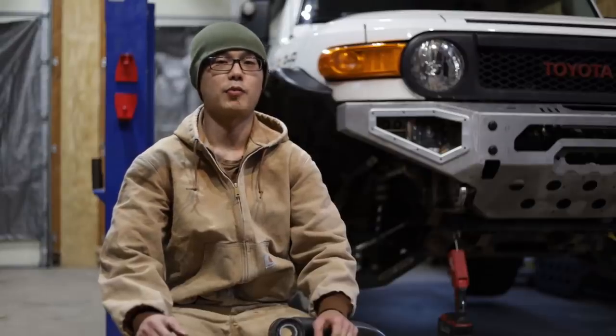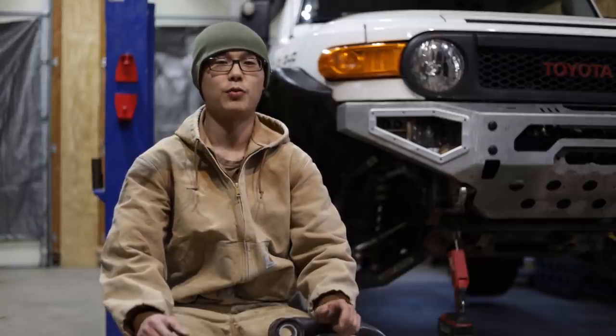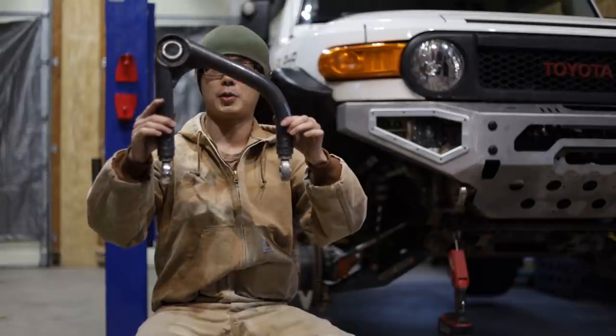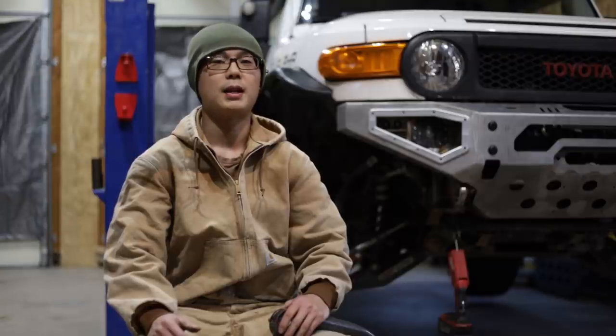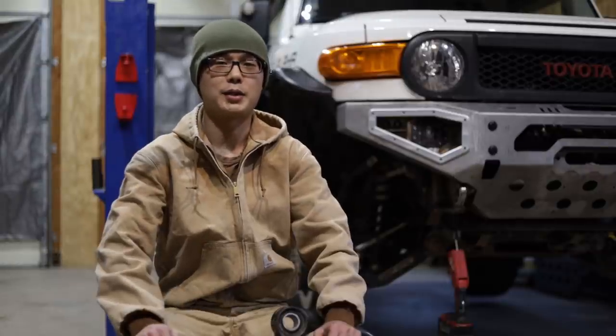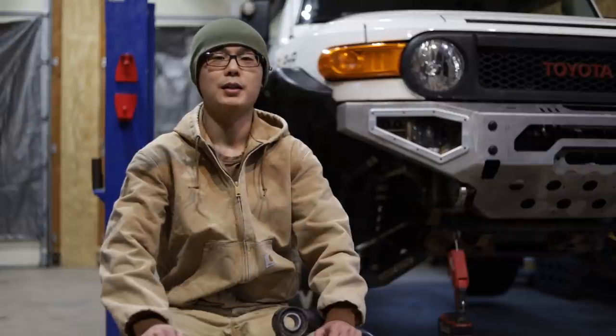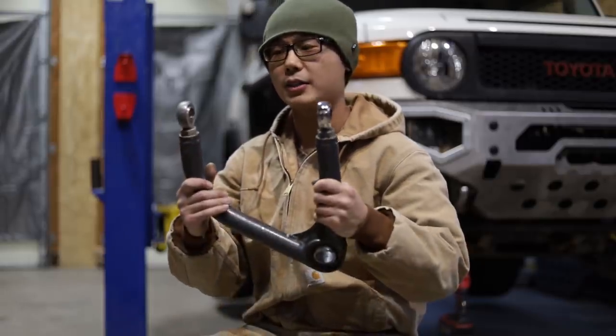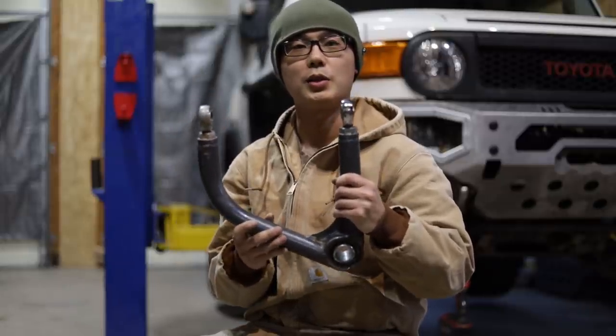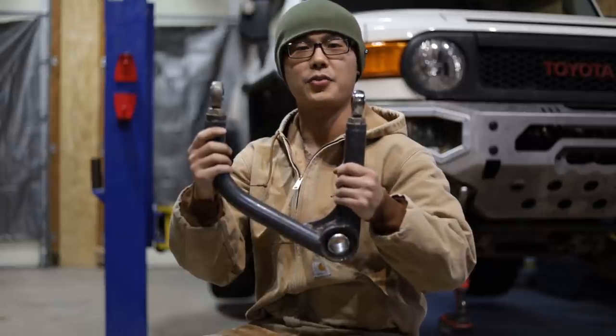Let's come back to the topic of wheel placement and wheel alignment. Our goal is to move the wheel forward to clear large tires, and we saw both designs can achieve this by a decent amount. However, due to Camber's high-caster upper control arm, I ended up with around 6 degrees of caster to barely clear my 35-inch tires. Caster provides the self-centering force for steering — not enough caster can cause wandering on the highway, but too much caster can cause high steering effort and will wear you out over long distance driving. From my experience, over 5 degrees will start to become not highway friendly. Some experienced viewers might ask: why can't I just adjust the rod ends on my upper control arm to reduce the caster while still pushing the wheel forward? That sounds feasible in theory, but on my particular setup, I ran out of threads before getting to where I wanted to be.